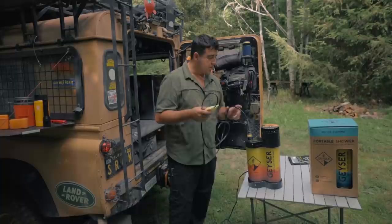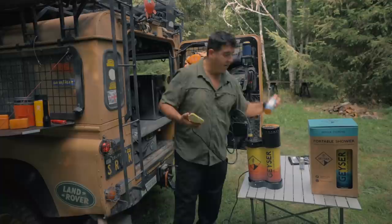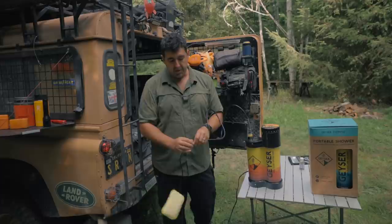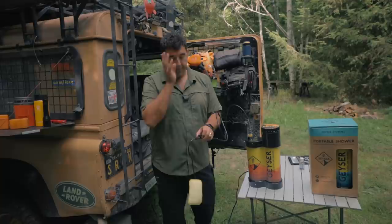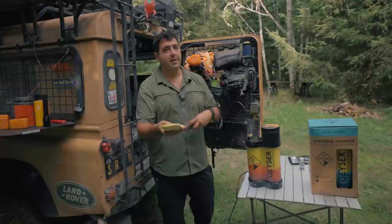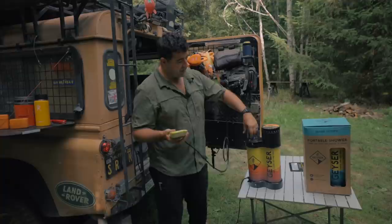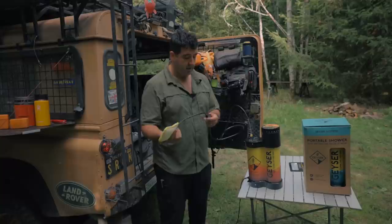So what we're going to do is use this without heating it up right now. It does come with the Castile soap. You get to adjust the volume of water flow with the valve. If it's fully open you get about a minute - it's a one-minute-per-gallon pump. When it's just cracked open you get about 15 minutes of use through the sponge. I found that about halfway you get about seven minutes, which is a really good amount of time. There's a little fuse in there - I've had one blow, so I'd recommend getting a replacement just in case.